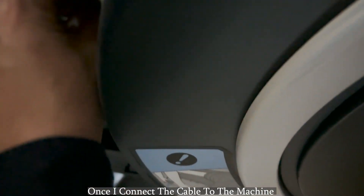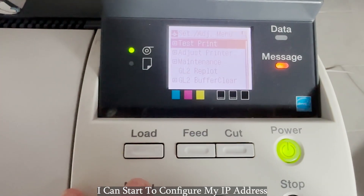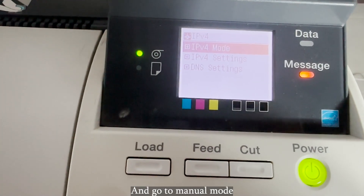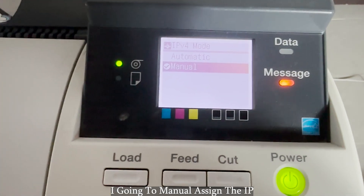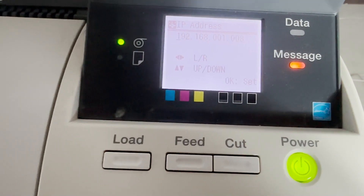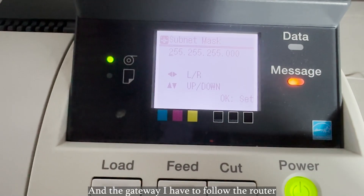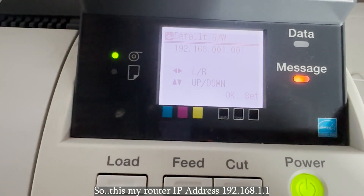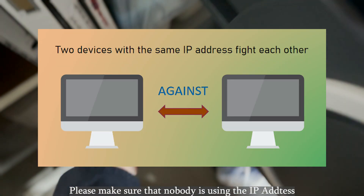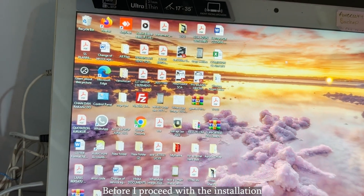Time for network connection. Once I connect the cable to the machine and the LED light is blinking, I can start to configure my IP address by going to TCP/IP, IP version 4, and switching to manual mode. I'll be using 192.168.8.8 as my IP. The subnet mask is 255.255.255.0, and for the gateway I follow the router. Please make sure nobody else is using that IP, or else the network will conflict and you won't have any connection to the router.